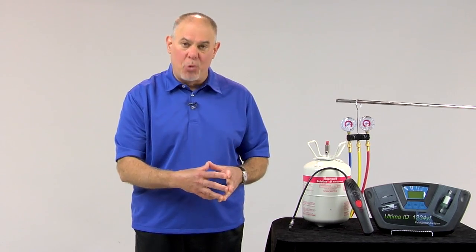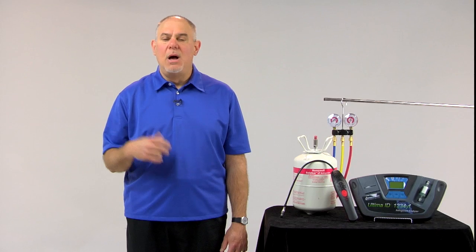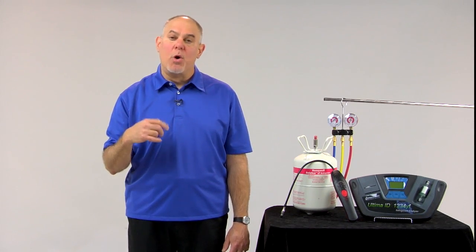One last thing: the U.S. EPA has granted emission credits to vehicle manufacturers who are using R1234YF. Removing R1234YF from a system and replacing it with another refrigerant would be considered emissions tampering and is a violation of federal regulations. This is one part of a three-part series brought to you by Honeywell on R1234YF. There are additional resources you can take advantage of, as well as Honeywell's smartphone app that brings you more information about their refrigerants. I'm Paul DiGiuseppe — thanks for watching this program on R1234YF systems.